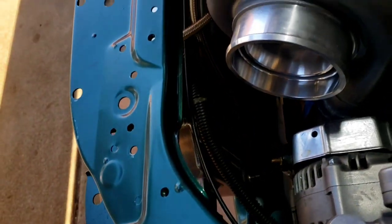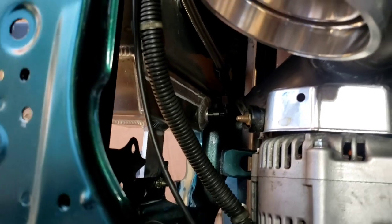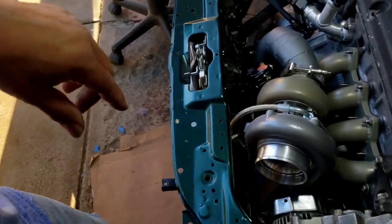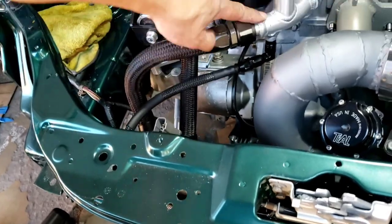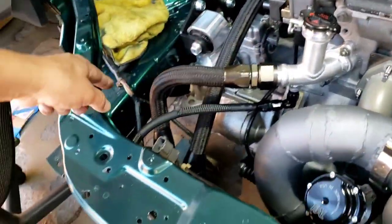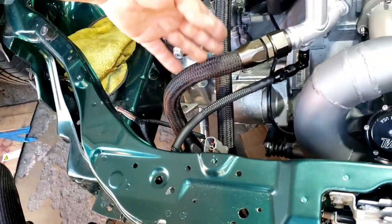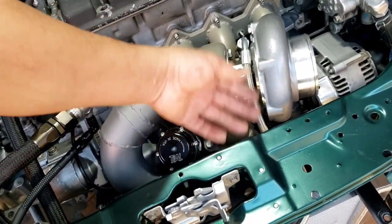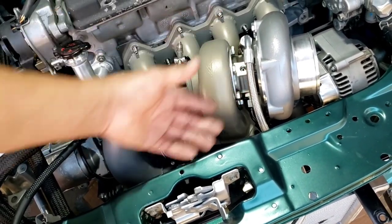And the return line goes to my radiator right there. That is by using a dash 6 AN to 6 ORB. And this is my inlet coming from my water neck, and it shoots out. I just put a sleeve on there just so it'll be uniform. And then over here, I'll put a heat sleeve on here. That will protect it from, you know, extreme heat.